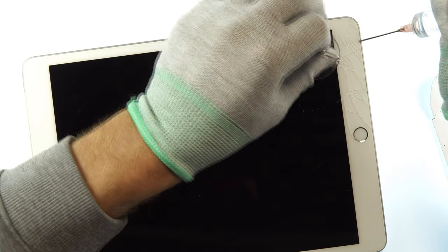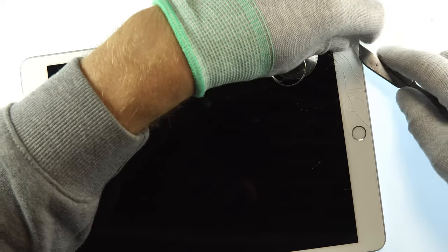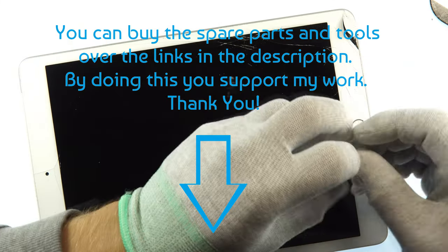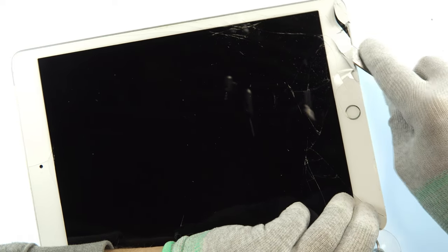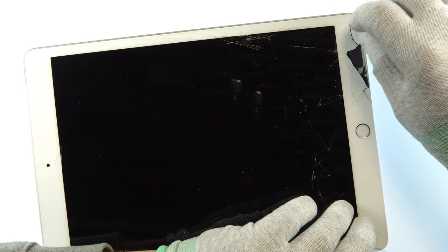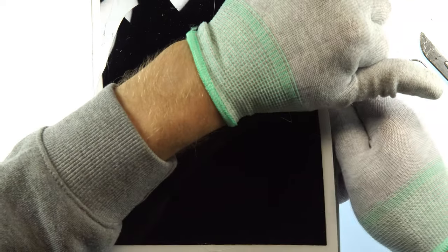As you can see it's not always going well even for professionals — sometimes the glass cracks. That's not a big issue since we can just replace it with a new one; it's not that expensive, but it would've been nice to reuse the original. I was nearly finished but then it cracked. The most important thing is that the home button is okay, because that cannot be replaced without losing Touch ID. There may have been a thin crack I didn't see, which caused the whole display to crack when prying.